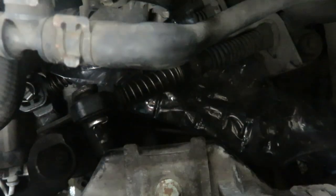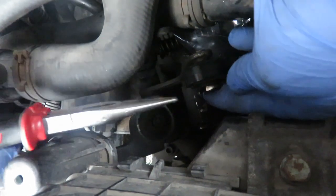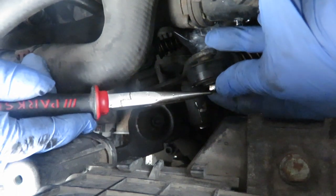Next I'm going to put a plastic funnel underneath the thermostat housing, but first I'm going to have to remove this clip that holds the gear shift to make a little bit more room to work. Put a little pressure outwards on the top spring and just slide it back — it should pop off.